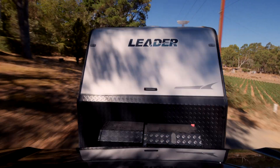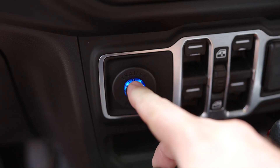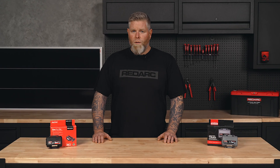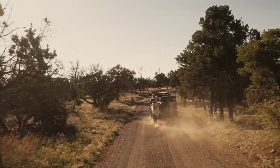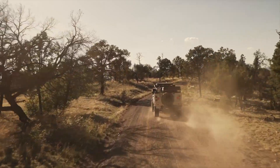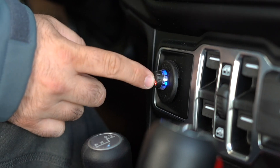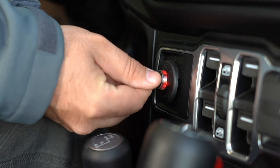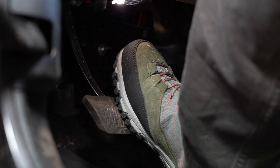The TowPro also features sway stop technology, applying the trailer brakes in emergency situations such as during trailer sway. Sway stop can be activated by pressing and holding the remote knob while driving. This applies the trailer brakes independently from the vehicle to safely pull the trailer back in line. In everyday mode, sway stop will apply the trailer brakes at a proportional level, and in manual off-road mode, the trailer brakes will be applied to the level set on the remote. Sway stop should not be used in place of the regular vehicle brakes.